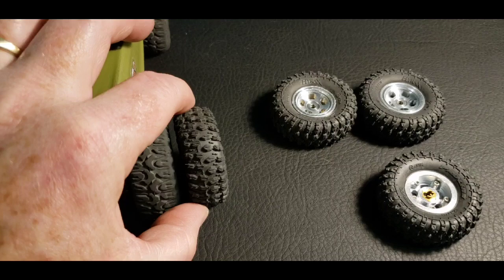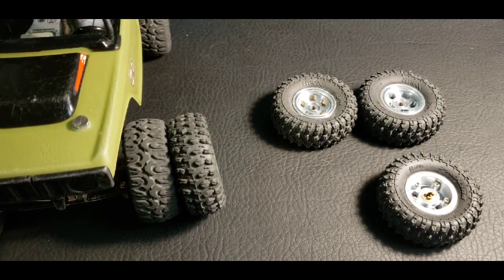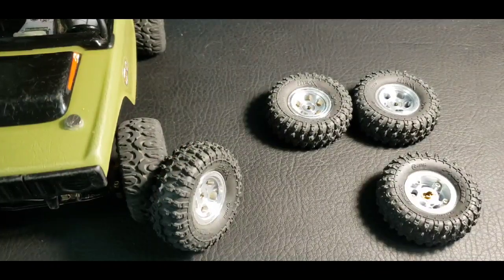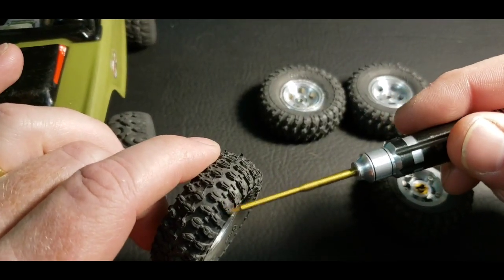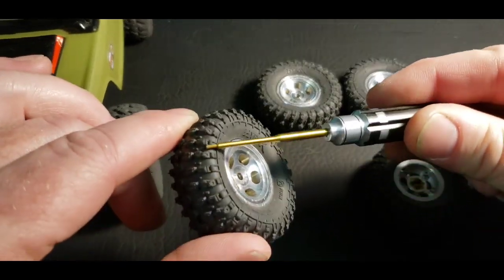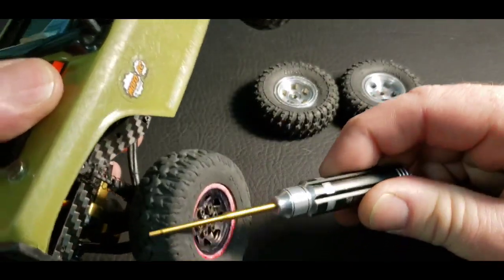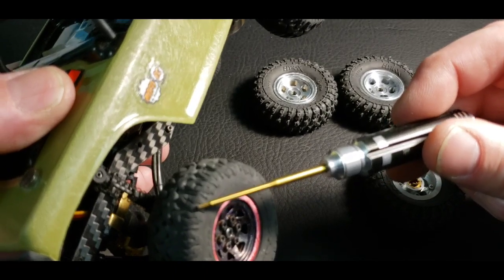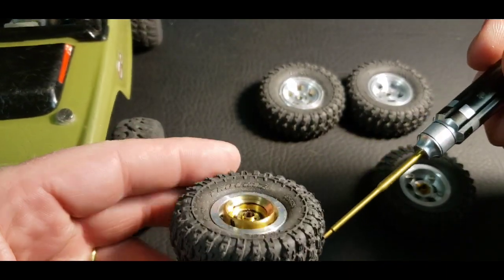They're a tiny bit narrower. It's about half a centimeter narrower, 5 millimeters or so. And one of the notable things about them is as you transition towards the sides of the tire, it's got sipes, these little cuts through it, and lugs, and you get a little bit more side grip. So if you get these tires against a wall of rock, it'll catch on these lugs that won't necessarily catch on the side of the Patagonias, because they're tighter and smoother. There is a little bit of that, but not to the same degree. And you'll notice that when you're driving it on rock, especially.